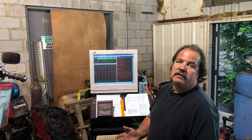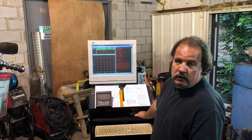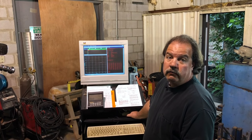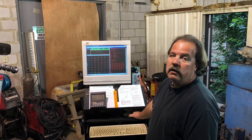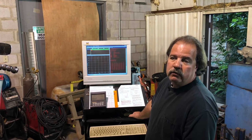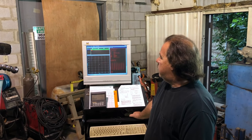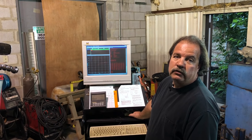So you're asking, what does this tell us? Well, over stock, or prior to how the motorcycle was tuned before, it lets us know exactly where we've gained and where we have lost power. This being a dresser tour bike, this lets us know exactly where our peak torque is for pulling two people out onto the highway. We're doing some tour riding, going up into the mountains, up big hills, pulling a trailer. We have our peak horsepower, which is going to help us out on the highway, passing cars, running with our buddies.